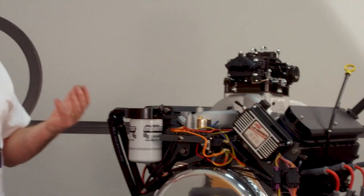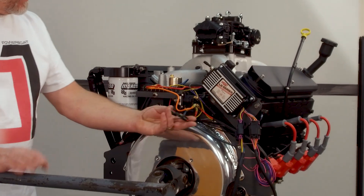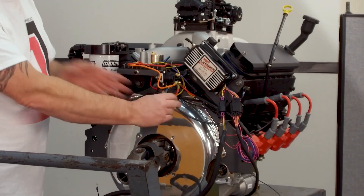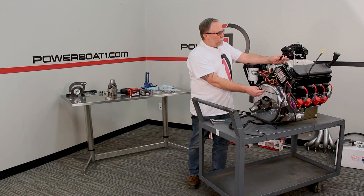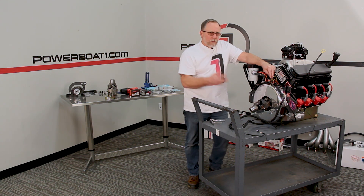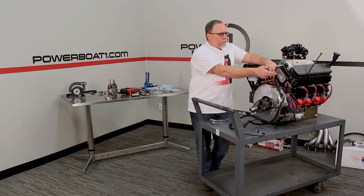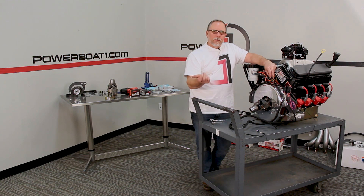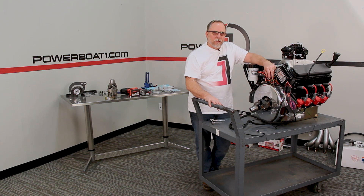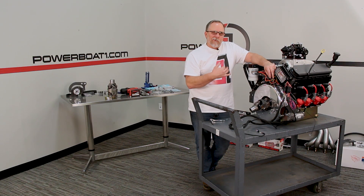This is going to be our ground and our tach lead that will connect into our harness, and then this will be our power from our relay that'll actually turn the box on and off. So when you turn the key on, it'll energize the wire here which will turn the box on. Turn your key off, it'll shut the box off and shut the engine off. Really a pretty simple thing to install. Looks a little messy right now but once we get it in the stringers we'll get all that straightened up — it'll look really clean when it's done.